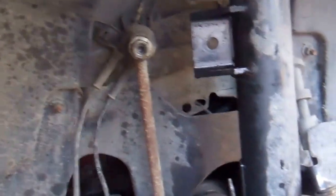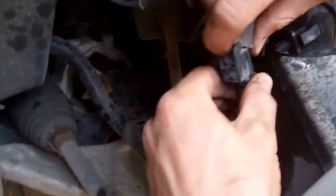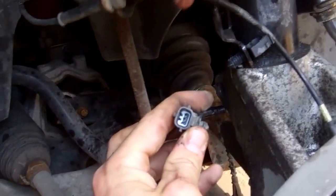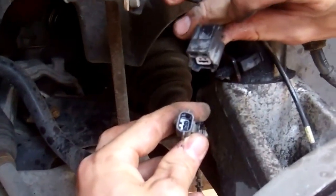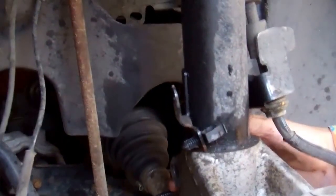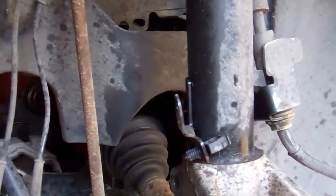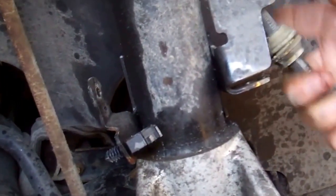Put the nut back on there - good idea. We've got another wire, another little cable there clipped in - that's the ABS. And then we unplug this sensor here - watch this one, this is the one that goes up into the underneath of the shock. Now you might not have that because ours is a dynamic, so it's got some witchcraft in the shock absorber. That's that all clear.